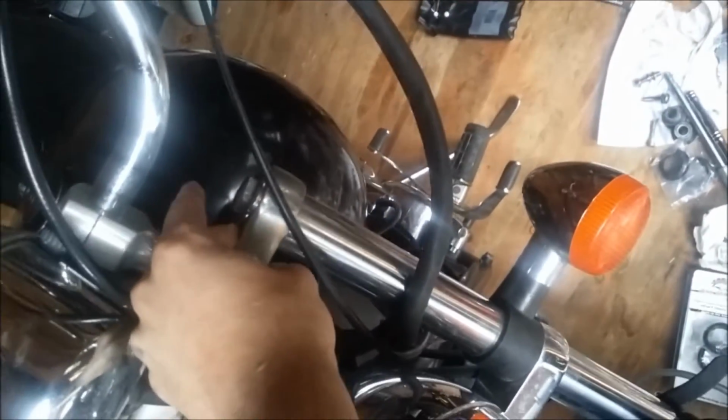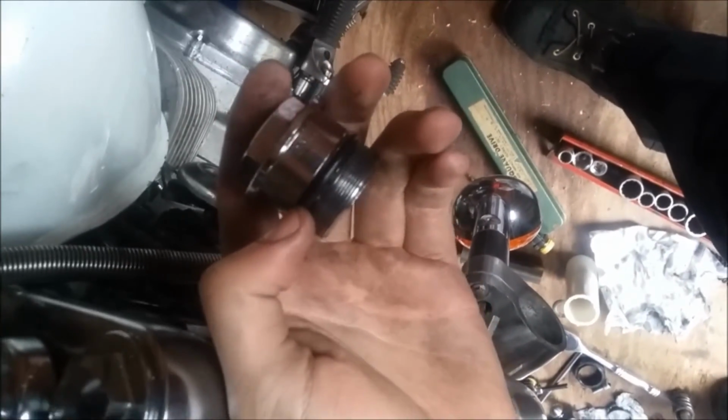On a bike like this, you have two sets of pinch bolts, upper and lower, being here and here. So this full fork will actually slide all the way out of the tree, including the top nut. On a bike like this, you can take the fork out and you can take these out, but these have to come up and out. I suppose the fork goes down and out, because these have these little seals and the top rim is wider than the top of the fork. They do that because there's only lower pinch bolts, and that's what holds it in at the top.